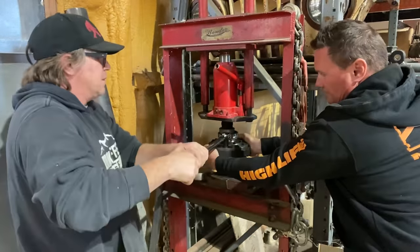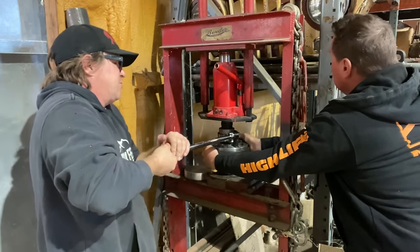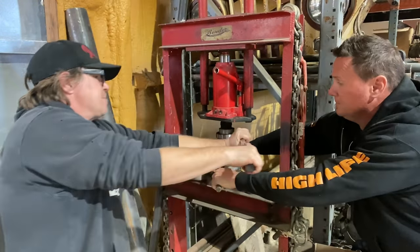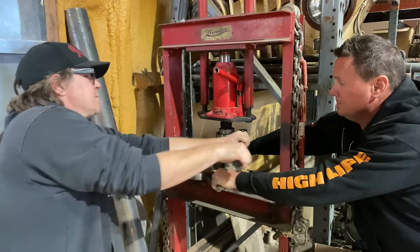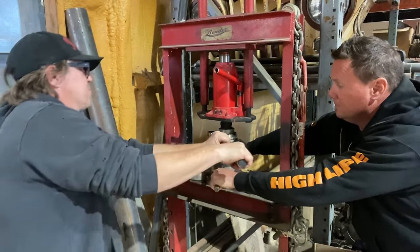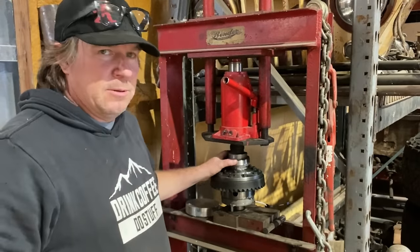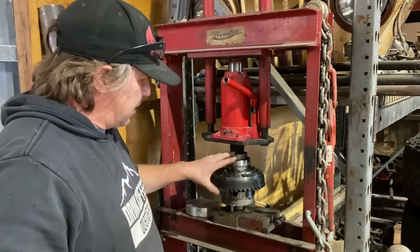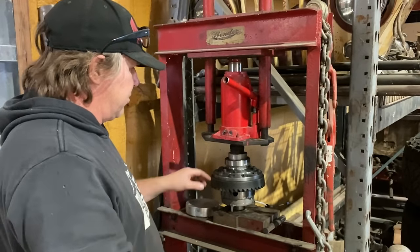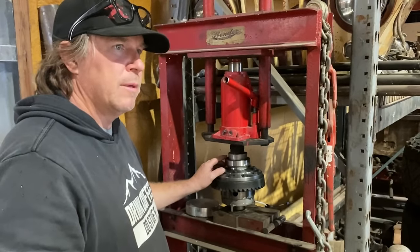That's it. We press the locker into the press. We're holding it with the press to try and torque the ring gear bolts. Just kind of a neat trick. We use the press to press on one of the side bearings. Then we clamped down on the press and put some tubes in there and locked and torqued the ring gear bolts. Now we're gonna flip it over, put the other side bearing in, the carrier bearing, and then we're gonna push it in the housing and set lash.